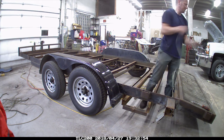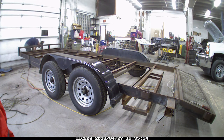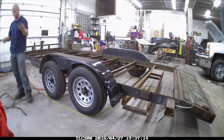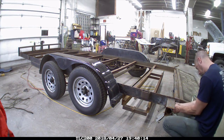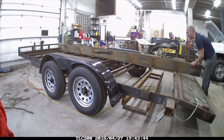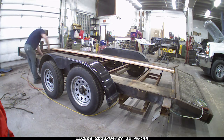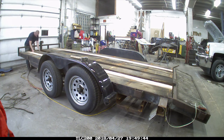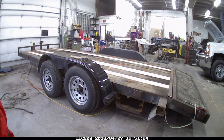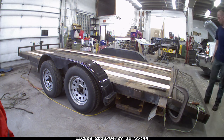I'm going to blow it all off and put our wires in. This is regular trailer wire loom - it's got the four wires in it. I'm going to run two wires to the other side for the stop light and the marker light. Now I'm going to put the boards back in, then put the angle iron back on, clamp it down and get it nice and tight to hold those boards in there tight, and then weld it up.